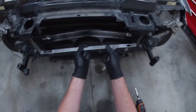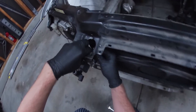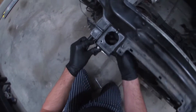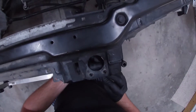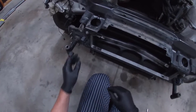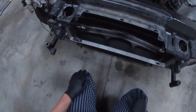Super easy. I just feed my 10 mils through — you can get one at a time probably easier. The 10 mil feeds in from the back here. Just need to get it on there. Same for the other side. Biggest thing with these is making sure on the back that the washers sit flush because they can get crooked, and you're going to go into a position where you can't mount the intercooler up properly. But basically, I just get those up so everything's loose and can be moved.